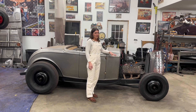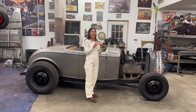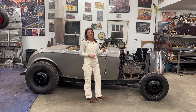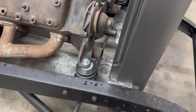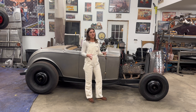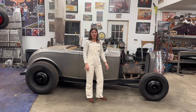I also wanted to see what was going on in the front. I took a 1932 original crossmember and kind of put a Model A crossmember to get the look that I wanted. I really wanted those original motor mounts because I think they look a lot better than the mounts that are on the frame. They make the motor kind of look like it's floating, which I think is really cool. However, it doesn't get me low enough, so I morphed them both together, and I think it's working.